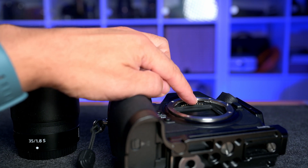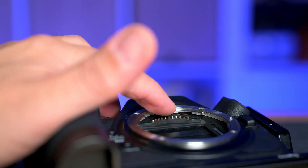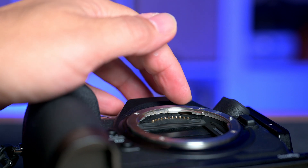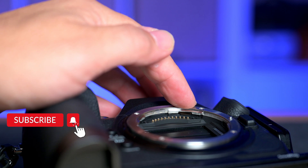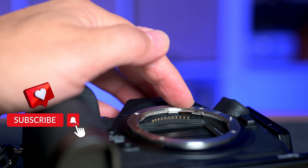Inside here are the leaf springs — these are tension springs that provide a bit of resistance to the lens rotating. As you can see, as the bayonet goes in and twists over it hits that tension spring, and that spring is what slows down or offers just that bit of resistance to the lens rotating. One thing you might notice is it sits at about a 10–15 degree angle from where the lens goes into the Z mount itself.